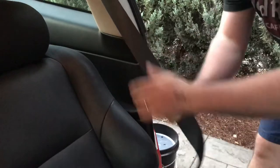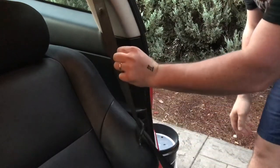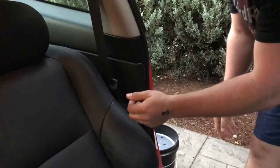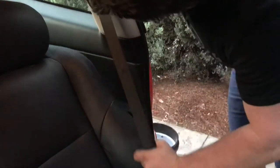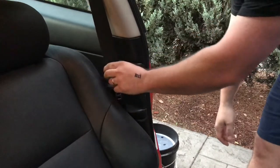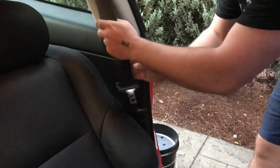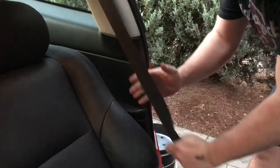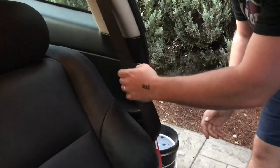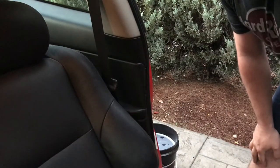As you can see, the seatbelt, once it's fully retracted, zips out pretty quick, but then it eventually gets to here and starts getting stuck and you've got to sort of assist it into the retractor. So basically today the job is to get this to retract faster. I feel like this spot with the little grommet thing is actually the stopping point. I want to clean this up so it fully retracts, because right now you've got to sort of force it back in.